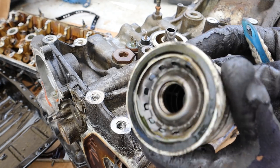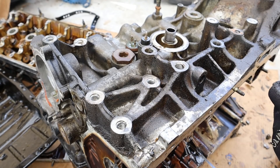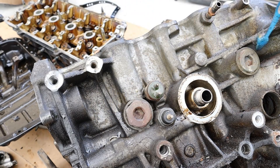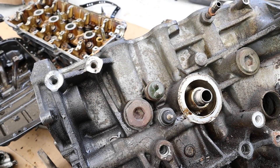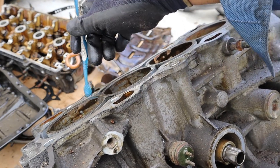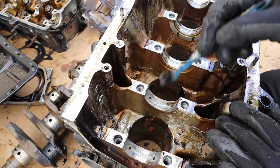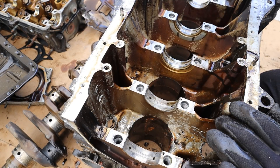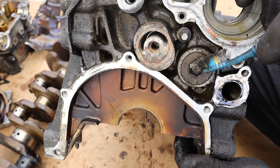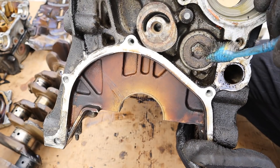I took off this oil filter and I don't notice any particles inside — this filter actually looks fairly clean on the inside. So I bet someone was trying to do a last-minute job when they found out this engine ran out of oil. Now looking at this design, once the oil is filtered out there is a galley that runs along the block and over to the backside, which is going to lubricate all of your main cap bearings and your crankshaft connecting rod bearings. There's also another main oil galley that comes up to the top to feed the head, and we do have oil return ports which draw the oil from the head back down to be recirculated. Looking down underneath the block, you can see that main oil galley that runs along the length of the block — the main bearings are drilled down and tap into that oil to lubricate the crankshaft and connecting rod. One good thing with engines from back in the day is that these oil galleys are accessible when you want to rebuild — you just unbolt and clean everything out; they're not sealed off with any pressed-in balls or welded-over caps.